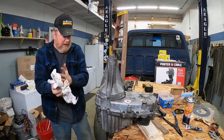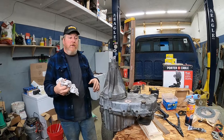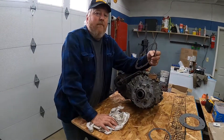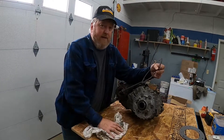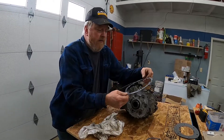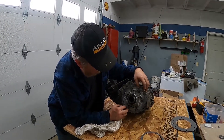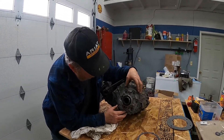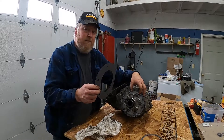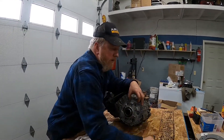So that's pretty much it. I'm going to get cleaned up a little bit and get this less precariously perched here. We're going to bring you back and show you shifting through the gears and making sure everything works before we put it in the truck. You remember the seal I was mucking with on the output tail shaft? It actually goes right here — you'll notice the holes are not evenly spaced, so that's where that seal goes. This other one, I believe, goes between the spacer and the transmission, which we're not going to get into because we know ours is fine. We also wanted to give you a little highlight of the upcoming videos: the ball joints are up there, front U-joint, and we've picked up a metal chop saw. All the steel for the flatbed is en route, should be here sometime in the middle of the week.